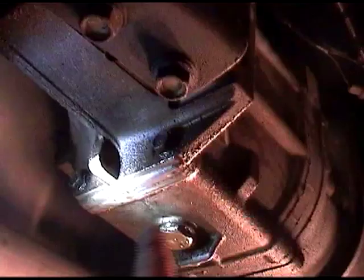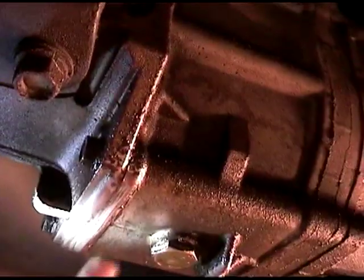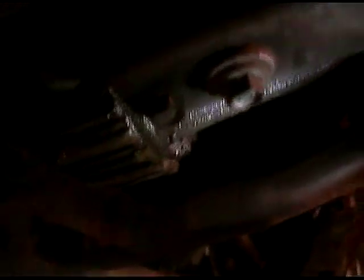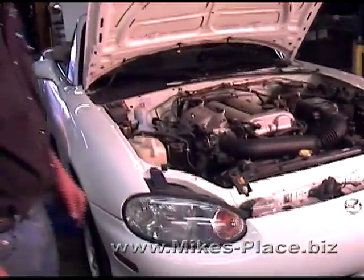Now we're going to check over the car for leaks — brake calipers, and up at the engine. Pretty dry on both sides. As we come back, it looks like we've got a leak here. When there's a leak, the leak will clean the surface around it. It looks like we have a leak at the case seam of the standard transmission — fairly common for the Mazda Miata. This leak is blowing back and I can smell burnt gear oil on the catalytic converter shield. It also looks like the differential is leaking, but that's actually oil blowing back from the transmission leak onto the differential.